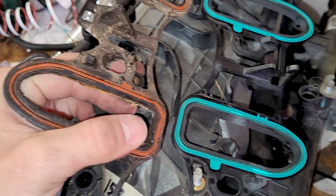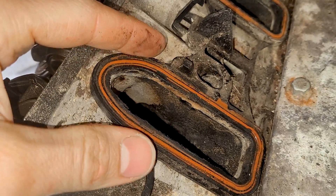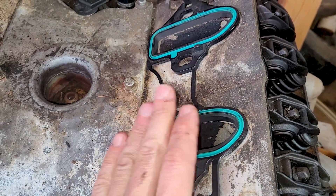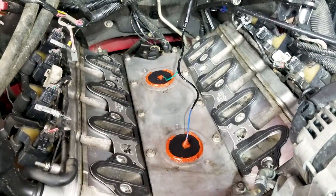The biggest problem with these is the top of the intake manifold — these things leak like crazy, especially from the factory. If you've got an early one, 1999 to about 2002, they have red intake manifold gaskets. If you see those, they're defective — not good from the factory. If you see green ones, they've been upgraded. I personally like to use the Felpro metal ones; they work the best and seal the best.